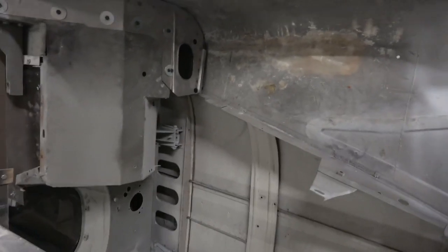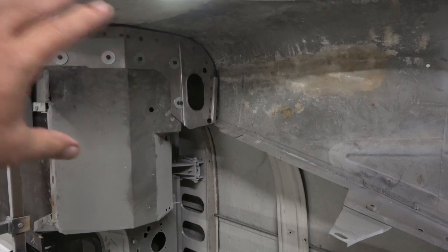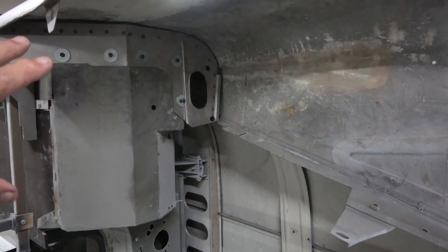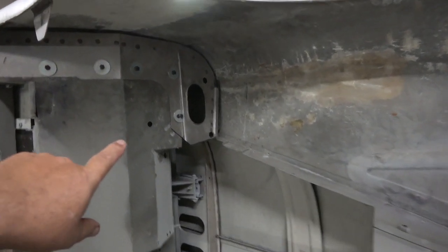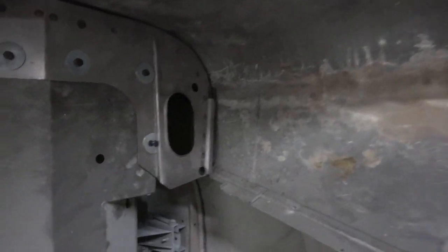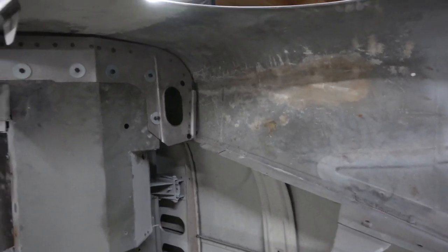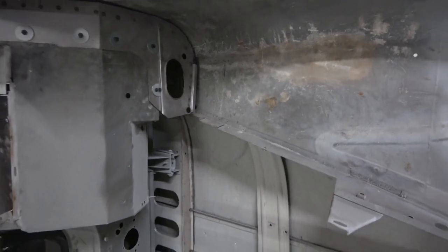Okay, so back on the XK, I've got this, I'm not actually sure what it's called, I just think it's a shield, inner wing shield, but I think they call it a hockey stick because of the shape. So what I had to do was obviously cut down that washer there where that lip is, you can see in there. And I had to elongate this hole on the end slightly, but apart from that the rest seemed to work.